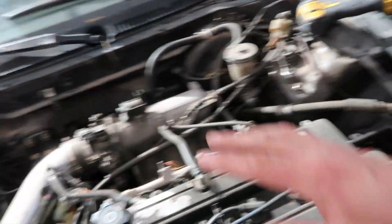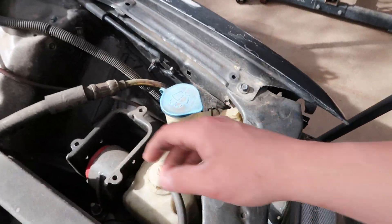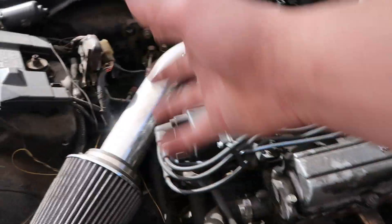I'm going to start off by disconnecting as much as I can on top. I'll more than likely miss something — whenever you're pulling an engine out you think everything's unhooked, get underneath, start undoing the T-bracket, and then realize you forgot the fuel return or something. I'm going to get all the fuel lines disconnected, pull the radiator, pull the intake off, unplug the wiring harness, all that.